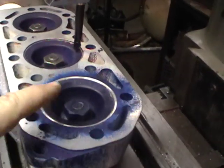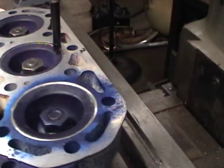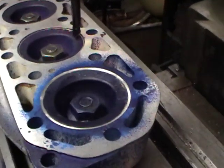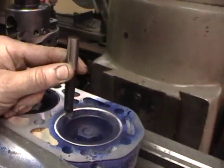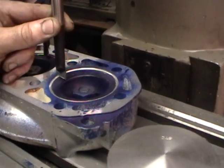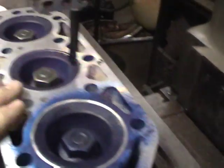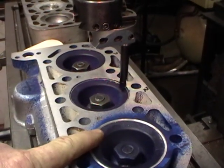What we'll do next is use a special tool that's the same angle as the plane on the head. Here's a special tool we've made for the mill — it's got the same angle as the combustion chamber angle. We'll drop this area down once the flat surface is true, to get back to that twenty-eight to twenty-nine thousandths area.